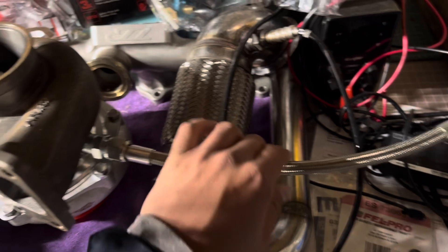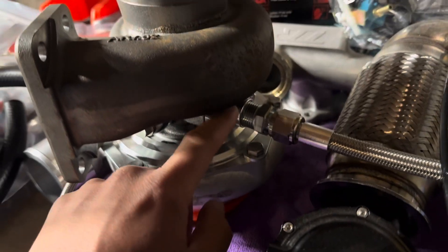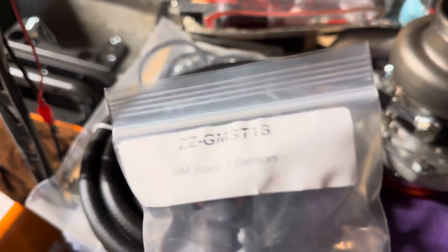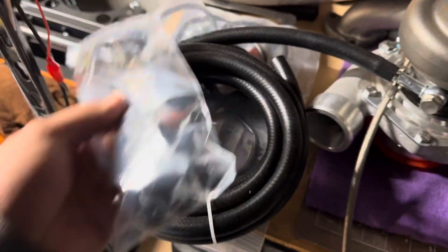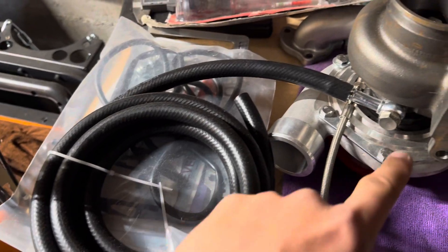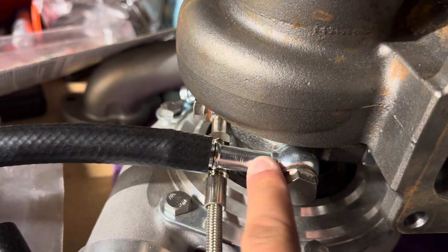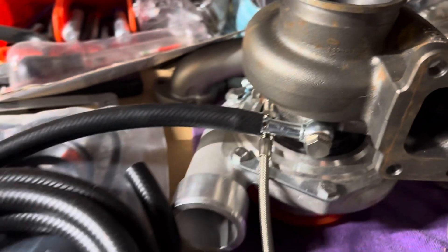I would love your guys' feedback. This, I believe, is the oil drain line because it's going to come off the bottom — that's going to be oriented downwards. Then obviously we could clock this however we need for in the car. These are three bar MAP sensors, GM stage one from ZZ Performance. So how to source these, how to source half inch — this is fuel line, but I'm going to use it for coolant lines. If anyone has a better way to run these banjo bolts that came with the turbo, or any solution line wise, please let me know.